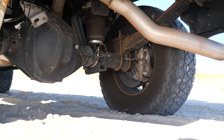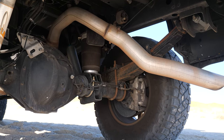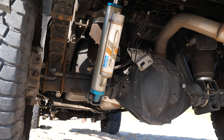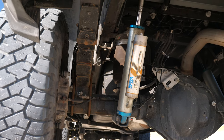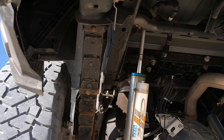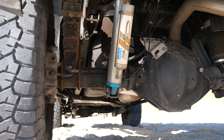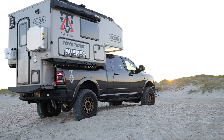On the back of the truck, the rear suspension — we're running a custom spring pack like we typically do on our trucks. It's the factory spring rate, so it is a progressive rate, but we got rid of the lift block that comes on the factory spring pack. It's standing a little taller than stock, but it's there to balance the truck well for a 37 and give us added compression travel from this height. We got a great deal of articulation on this as well as the long travel airbag from Carly.